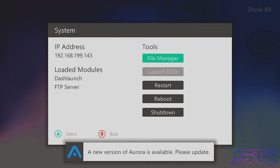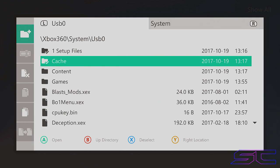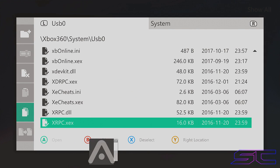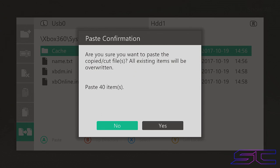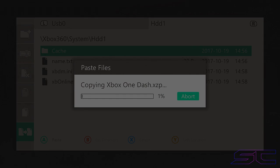Go to one setup files, then Aurora, making sure you're on USB0 since it's not on the hard drive yet. Start Aurora again, click the back button, and go to file manager. This time go to USB0 and select everything just like before, copy it, then go to HDD1, click RB, select HDD1, click paste, then yes. And there you go — you have a cloned or upgraded hard drive. You can do this with pretty much any hard drive. Hope you enjoyed the video and it helps you out — give it a thumbs up and have a great day!